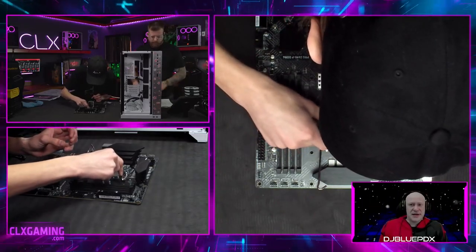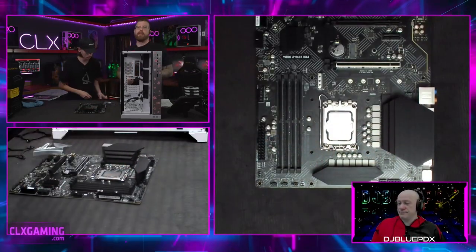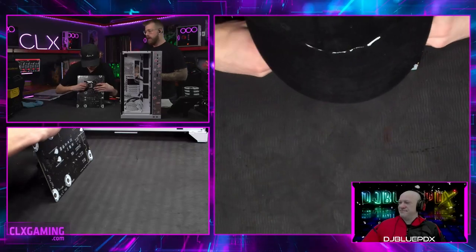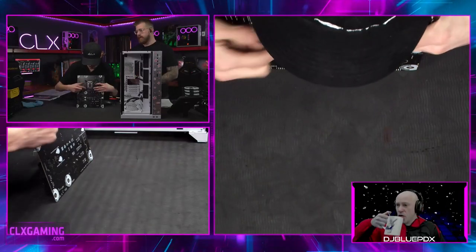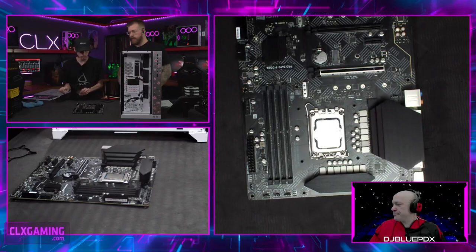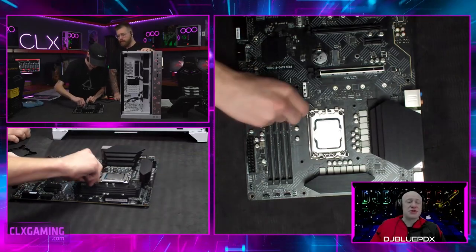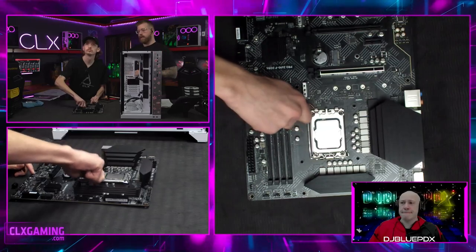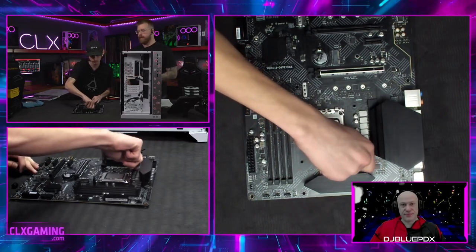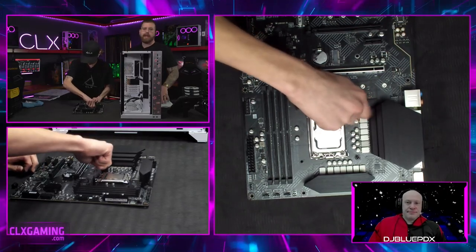The K means unlocked, so we can overclock this processor if we want to. The F means this processor will not have onboard video. Sometimes you'll also see S, which is a special edition that usually has really good clock speeds. The KF model has the same clock speeds as a regular K — the only difference is no onboard video, so you can get the KF a little cheaper. If you've got a video card and aren't using onboard video, the KF saves you a few bucks.